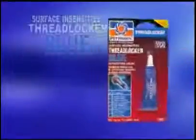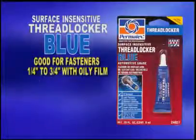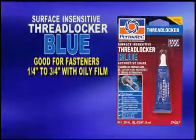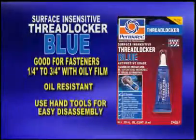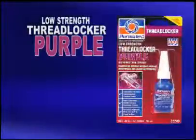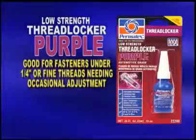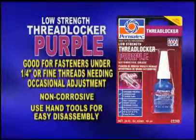Permatex Surface Insensitive Thread Locker Blue is a medium to high strength thread locker for general purpose applications. It's especially well suited for 1/4 inch to 3/4 inch fasteners that have a slight oil film. Surface Insensitive Thread Locker Blue is oil resistant and is removable with hand tools for easy disassembly. Permatex Low Strength Thread Locker Purple is a low-strength thread locker designed for fasteners under 1/4 inch or fine threads that require occasional adjustment. It's non-corrosive and removable with hand tools for easy disassembly.